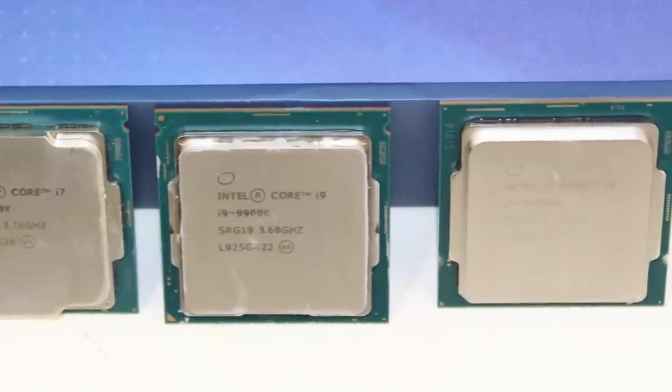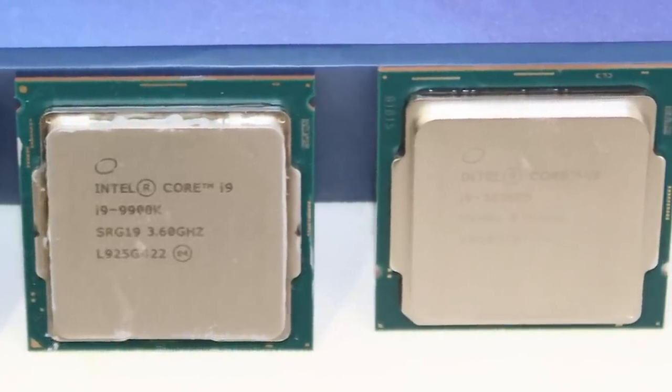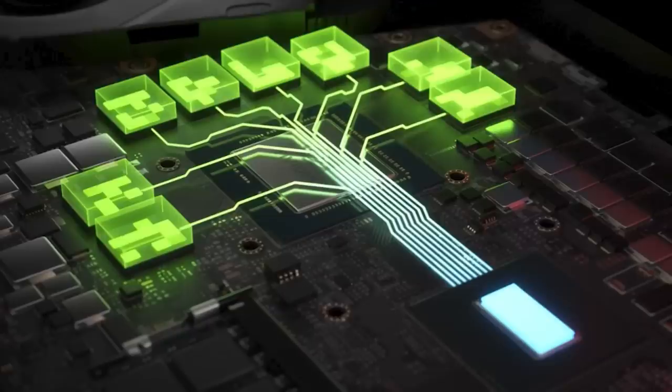We're looking at this on an AMD platform, but with a slight twist. I recently did look at this on an Intel Z490 and a 10900K using an RX 6800 XT. Unfortunately, as of the time I'm looking at this, NVIDIA don't have their driver updates for Ampere or other cards to take advantage of Resizable Bar. It is coming — I did reach out to NVIDIA recently, and they said they don't have an exact date, but we shouldn't have to wait much longer. Either way, the 6800 XT on an Intel platform performed wonderfully, assuming your board has a BIOS which allows you to utilize it.